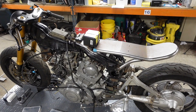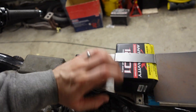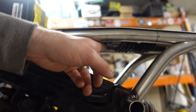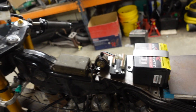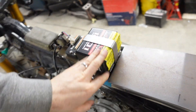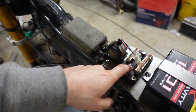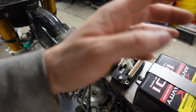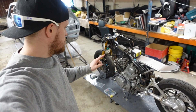In this episode we're going to start looking at the electrical system — I've got to say I'm not overly looking forward to it. What I've done is mounted a few bits under the fuel tank in the void created by the tank, and under the seat. Under the seat we've mounted the regulator rectifier, and under the tank we've mounted the starter solenoid, the Motogadget M Unit Blue, and the Anti-Gravity lithium battery. The only problem is the Bluetooth might struggle a little bit being under metal, but we've really got nowhere else to put it.